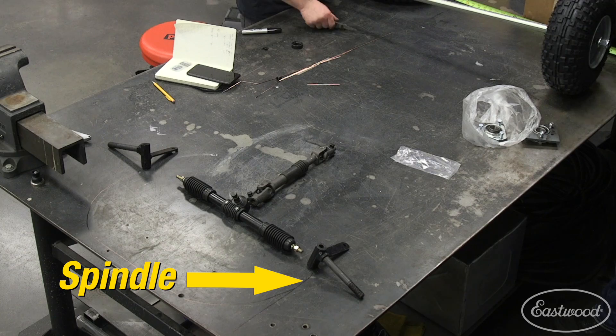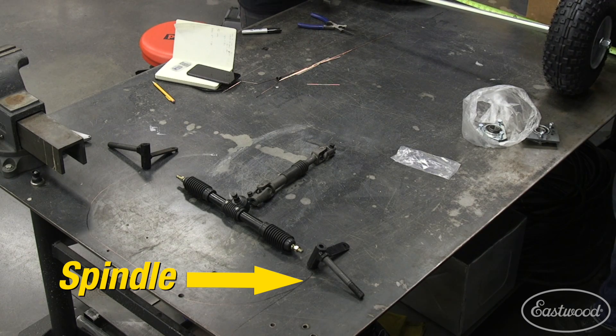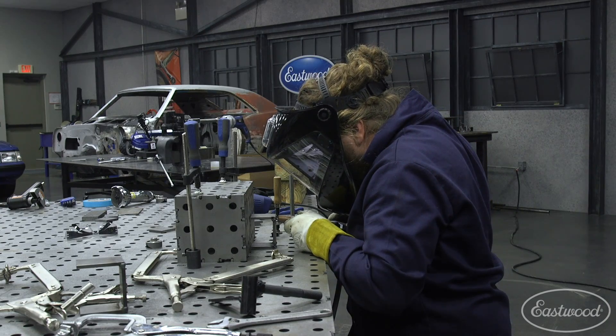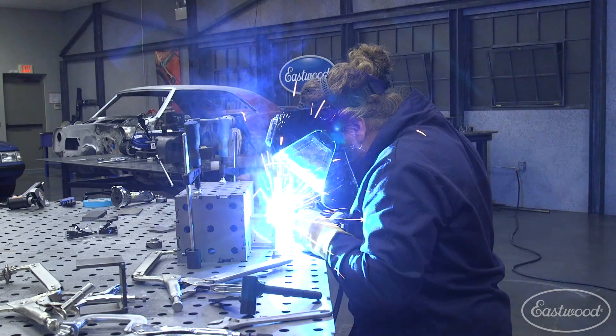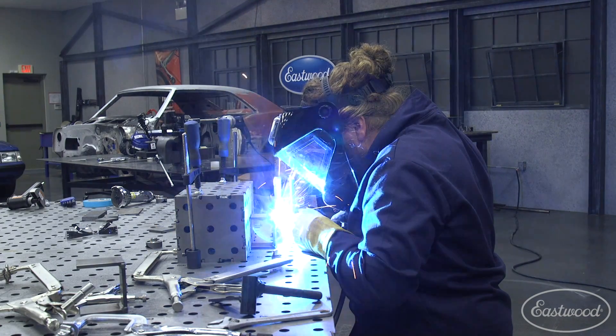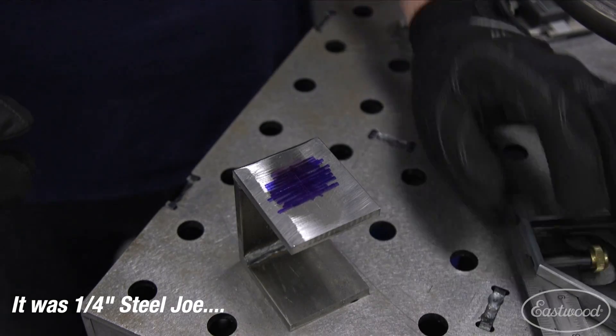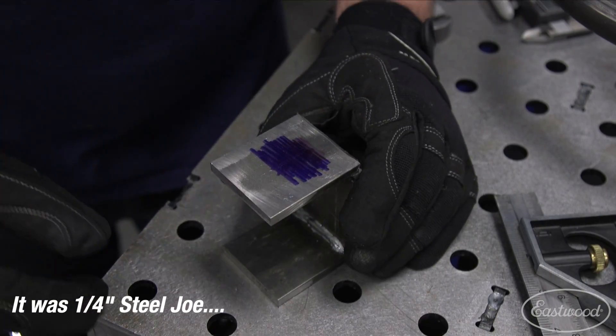The steering system comes with spindles, so the tire mounts directly to the spindle itself, but we need the spindles to mount to the frame. We came up with an idea to make these C-brackets — kept it pretty simple, used about eighth-inch to quarter-inch plate, a little C-channel that we can mount off the ends of our front axle. It worked out really well.